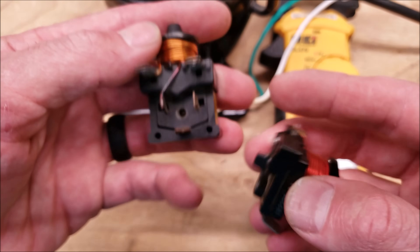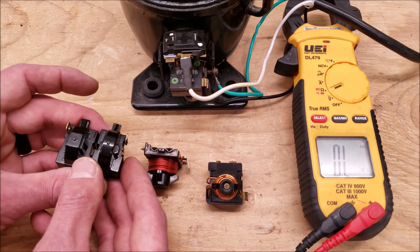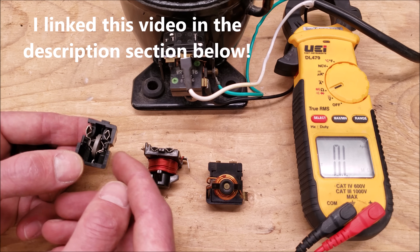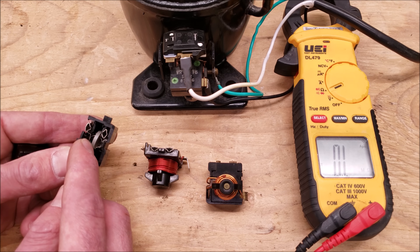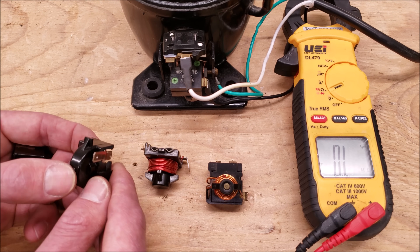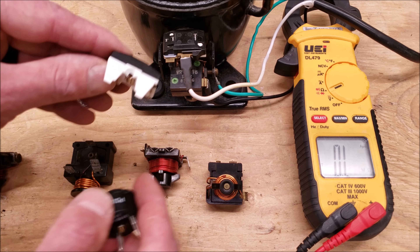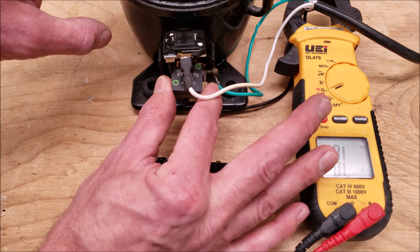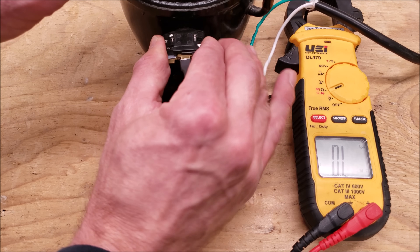You always want to make sure you know how each of these are mounted onto the compressor. The current starting relay should not be confused with the PTC thermistor, which is usually in a case that looks like this. Inside the PTC thermistor, as you draw amperage through that little disk, it heats up and opens so that you are no longer having start and run connected — you're just supplying power to the run. Used in conjunction with the current starting relay is a compressor protector, which may look like this or like this. Here are your two taps on the current starting relay and here is your compressor protector.